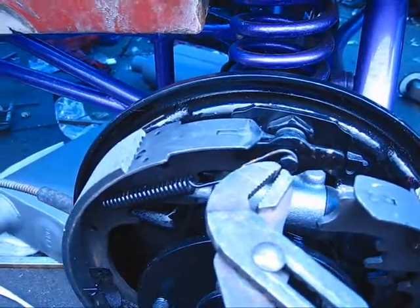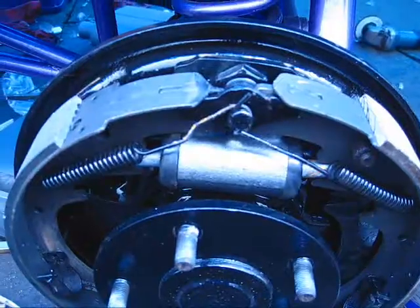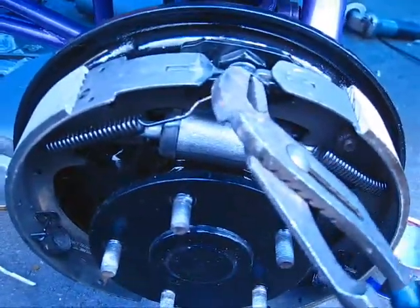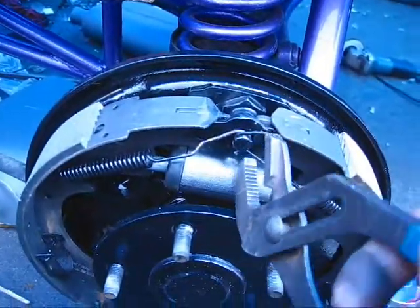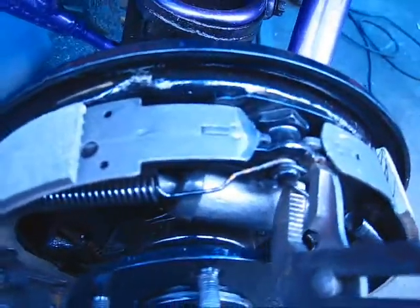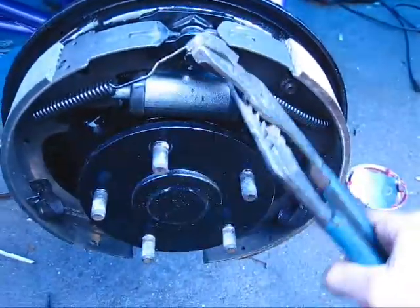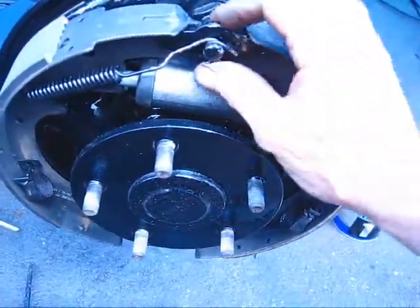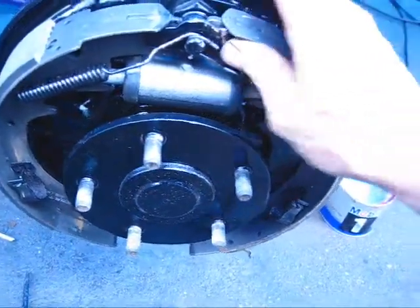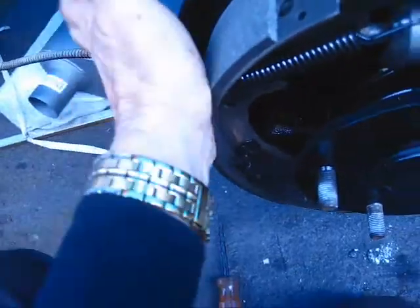This has to be twisted down to hold it in good. I'm using both hands. Even though the spring broke off a little bit, I just used my channel locks to clamp this down. The next thing is to put the other top spring on this bridge. I've used my channel locks to pull the spring and tighten it up. I've just bent that spring so it goes on, and you want to make sure this little keeper here is actually riding on this pivot point, so it's all in and flat.